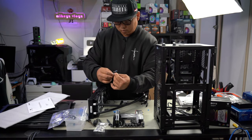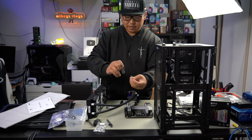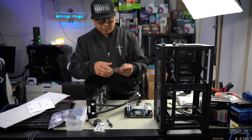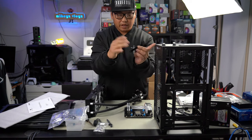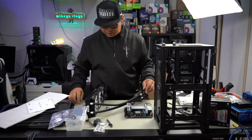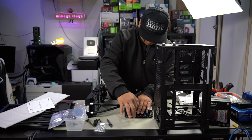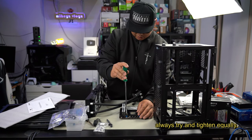Now we'll go to our box of goodies and get our mounting plate. Grab our screws, use the furthest point of this mount — there are two points to it. Push in the plastic washers to help hold your screws in place, rinse and repeat. That is our bracket ready. Now grab your standoffs — the blue ones — on the top you'll see 1700, just slide them straight on. We can now install our retainer for the pump using these two longer brackets with the V-shape going in, pushing them over your screws and standoff, then screw it down nice and snug — don't go too tight.